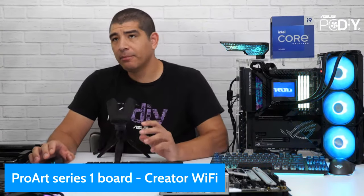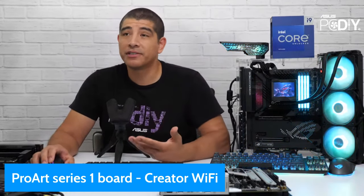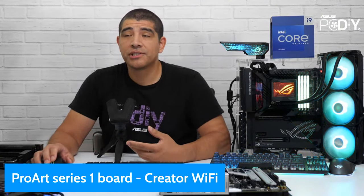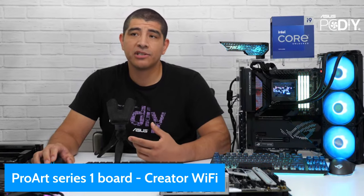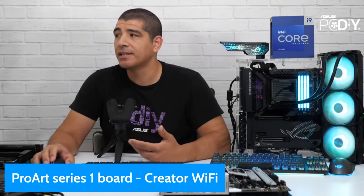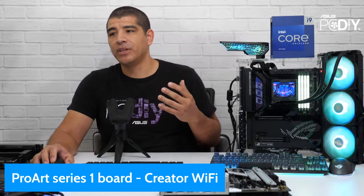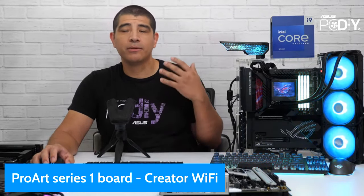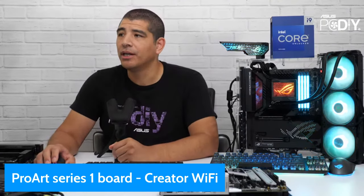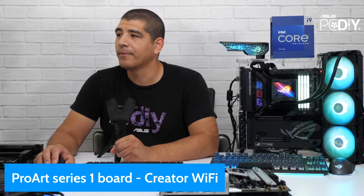And for DDR memory too, also keep in mind we have already validated this motherboard with support for over 7,000 MT/s. On the content creation side, especially for DRAM bandwidth, applications that do a lot of decompression and compression, that are actively pulling through memory, can actually show quite a benefit. That is a cool aspect that on this motherboard, even if you wanted to run 32 gigabytes or 64 gigabytes and be talking about high DDR5 frequency, it is entirely possible. It has very good memory topology and design in that regard, so you don't have to worry about it, okay?